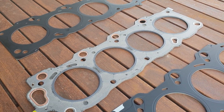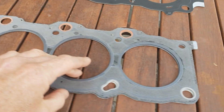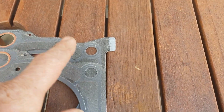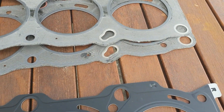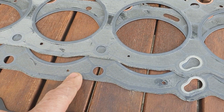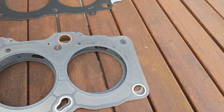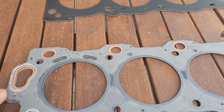Now the difference between the two gaskets — there's your oil feed here to the top, that's where the oil gets up. The difference is in the water drains. Comparing the right-hand to the left-hand, there's a difference in the water feeds — the water flow patterns between the cylinder heads is different. With the left-hand one on top you can see there's a hole; on the right-hand there are small holes in different spots. That gives an example of where the water flows. The main difference in the gaskets is just where the water flows, so be careful: left-hand hole in the middle, right-hand hole out to the side.